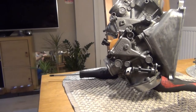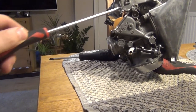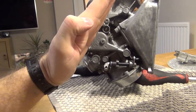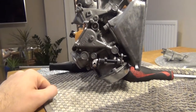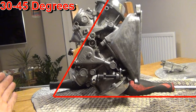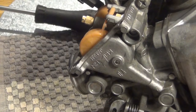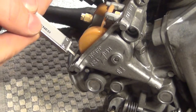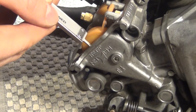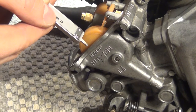The angle I'm talking about is the angle between this surface — where the gasket meets the carb body — and you want that angle to be between 30 and 45 degrees. I'm going to measure this with the caliper set to exactly 7.5 millimeters, measuring the float height from this surface. Look what happens — the float goes down and I'm squeezing it because the actual height is a lot more than 7.5 millimeters. It's probably nine or nine and a half millimeters.